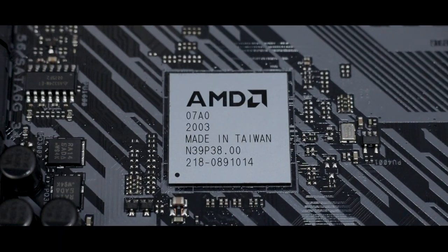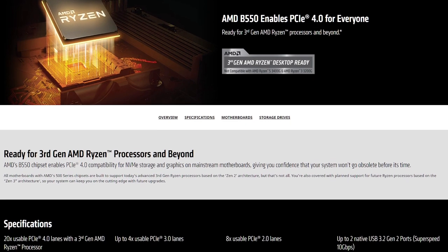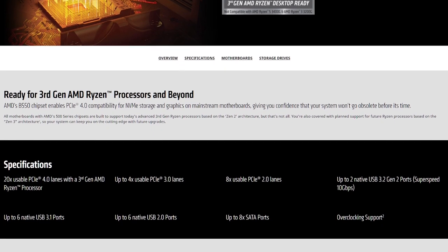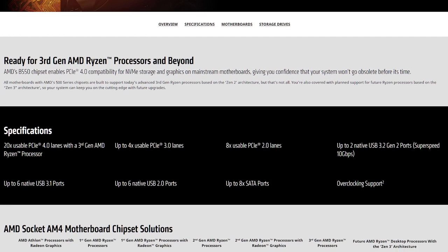What does make it pretty high up in the list is the B550 chipset itself, which brings with it some key features like support for blisteringly fast PCIe Gen 4 when partnered with a 3rd Gen Ryzen CPU, overclocking support, and promised support for AMD's upcoming Zen 3-based processors. But as you'll see from my testing and benchmarking a little later, even those of us with a 1st or 2nd Gen Ryzen chip can still benefit from the new tech.